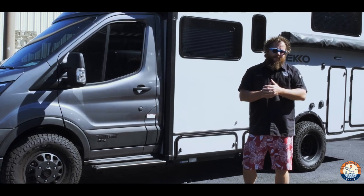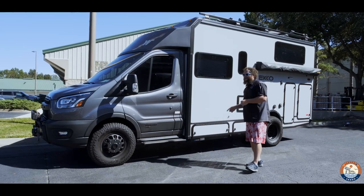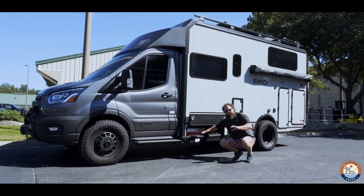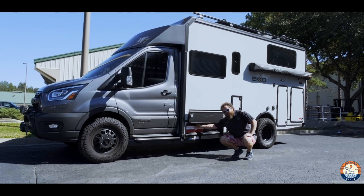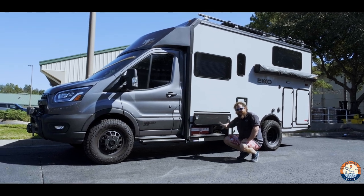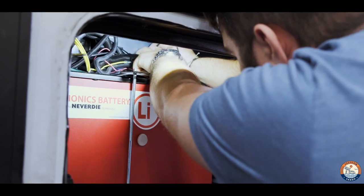For us, power usage and power generation is monstrous. So what we did is we added a second battery. We are lithium dealers and installers and we were able to add a second lithium battery using the Winnebago tie-downs we get directly from Winnebago, and then we built our own marine-grade wire for the jumpers — from the main battery to the secondary battery — wired in parallel.